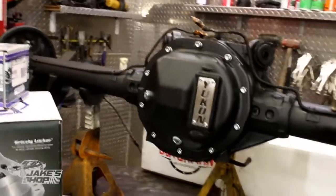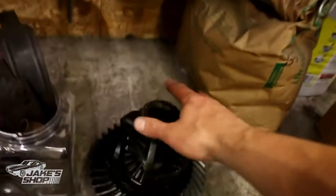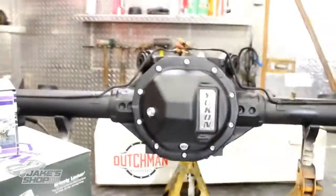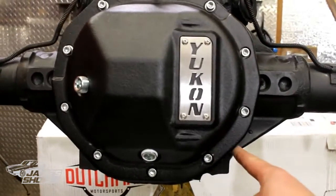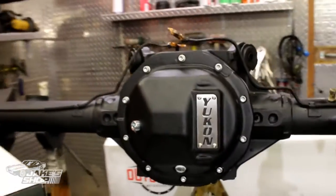This is an 8.5 10 bolt. What 10 bolt means is there's 10 bolts on the carrier itself. There's a lot of different types of 10 bolts. This is an 8.5, which is the larger of the 10 bolts in most of these setups. You can really tell because it has this wing and this ear here — that means it's an 8.5. It's a really solid axle assembly; you can really make these pretty beefy. The only downside is on an Oldsmobile and some of these BOP setups, you're probably going to have to go with a custom-made axle.